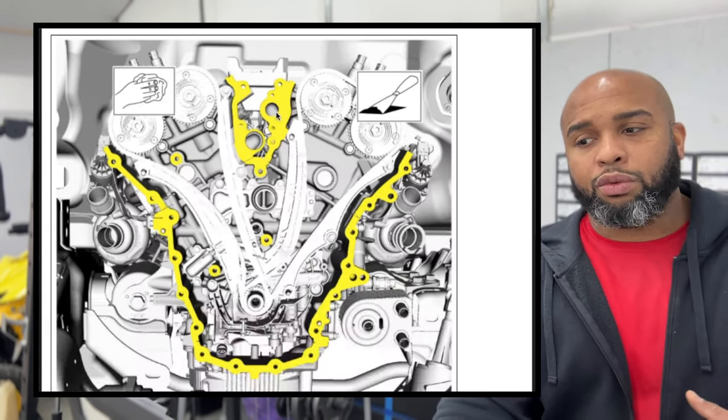So what I did do was for bolts 1 and 2, we finger tightened all the bolts that go in there. Then you tighten the bolt down one turn at a time. Then you repeat stages 1 and 2 until you reach 89 pounds. The reason you go back and forth is just because that high pressure fuel pump is spring loaded, so you don't want to do it cattywampus. You want to go back and forth, turn by turn, and once you get it down to 89 on each side, you'll go an additional 45 degrees.